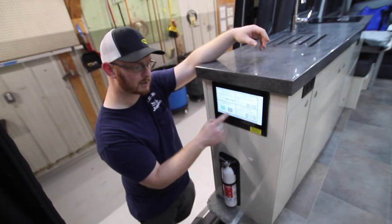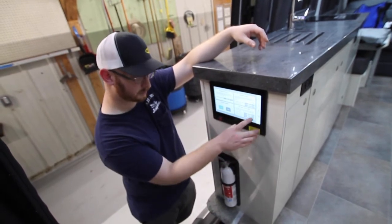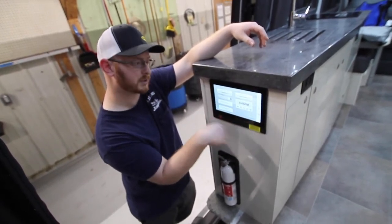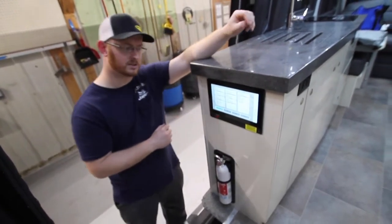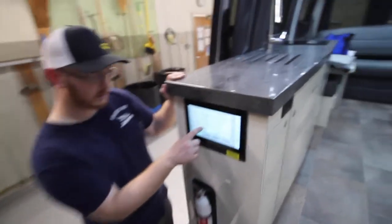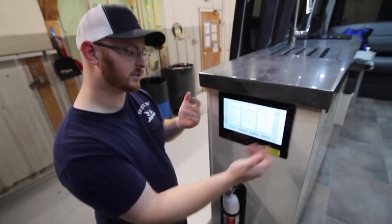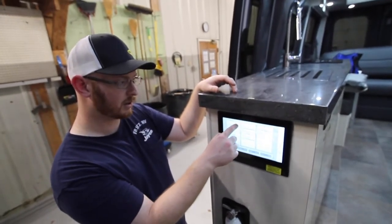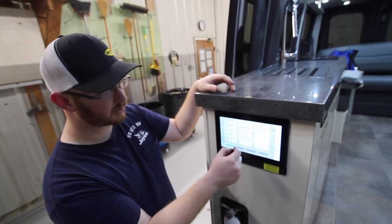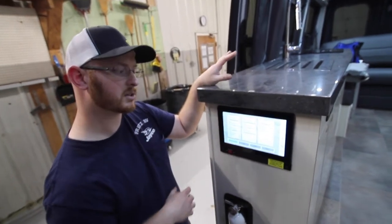You can change your default buttons, which are the three buttons on the main screen. Then we have diagnostics — what diagnostics does is show you things that are on and off throughout our 12-volt system. Right now you can see the air conditioner status is good. The G12 system is operating everything. We have our main LCD, entry LCD, vent fan, AC power monitor, DM3, solar controller, Truma for heat and AquaGo, and the RVC bridge that makes everything talk to each other.